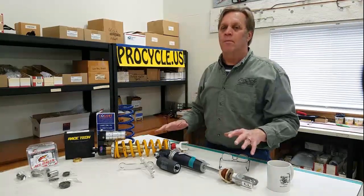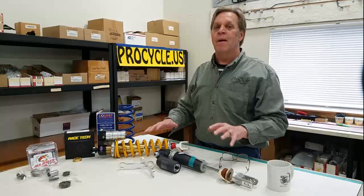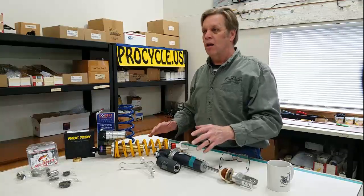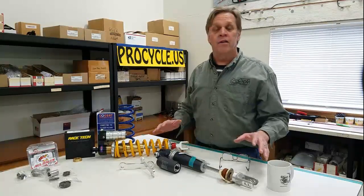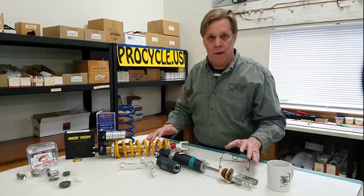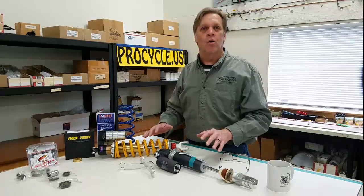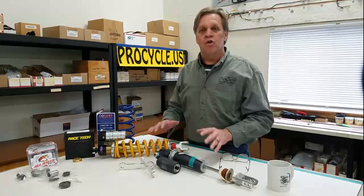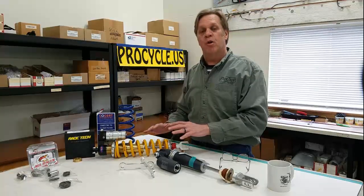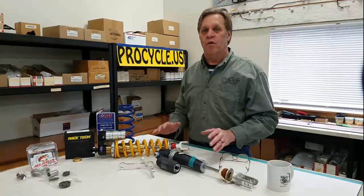One of the common things all motorcycle manufacturers do is when they make rear suspension for their motorcycles, they always make it pretty soft. They don't want anything that's threatening or a challenge to new riders. As your riding gets going along, you realize that you have a DR, a KLR, whatever your dual sport bike is, you realize you need a little better suspension. They bottom out, they pogo. So we're going to talk about what kind of suspension, how we're going to determine spring rate, and details like that to get your suspension dialed to make more of an enjoyable ride.